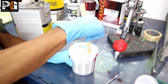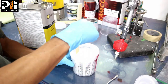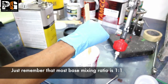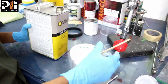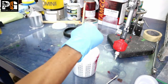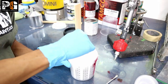Let's check the consistency. One, two, three — that's a little too thick. I can reduce it a little more. I like to see a rhythm of one, two, three — that's looking really good. You don't want your paint too thin because you'll have trouble with coverage; too thick and you'll get an orange peel texture and it won't flow out. A little too thin or a little too thick won't kill you, but you want to be pretty much in the middle. That last visual drip check looks really good — we're going to have good coverage.